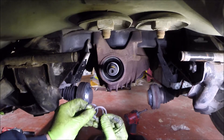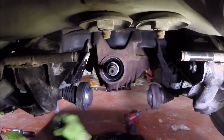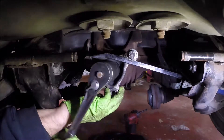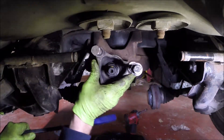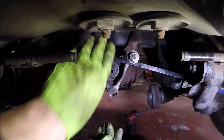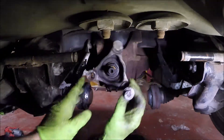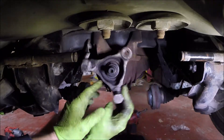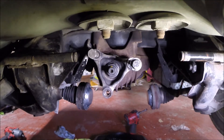This time we're doing a 10, a 12, and a 16 for a total of 38 thousandths. Getting the bearing in there. Before I go all the way with this I want to make sure we're still spinning smoothly — that's harder to spin, not quite locking up yet. Another thing I may have forgotten to mention: you're supposed to turn this thing around a few times just to make sure the bearing is seated properly. All right, let's see what I get.